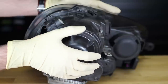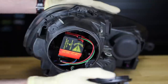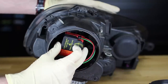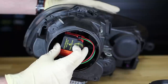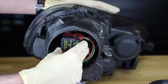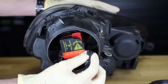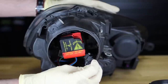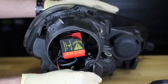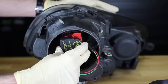We can start by turning this large cap counterclockwise — it's about a quarter of a turn. Now here we have the igniter on the back of the bulb. This is also snapped in place and you just turn that counterclockwise and it will lock out. What happens is this electrical connector for the igniter will actually release by itself when you turn that, so you don't have to worry about unplugging it beforehand. Now we can just slide this out of place.